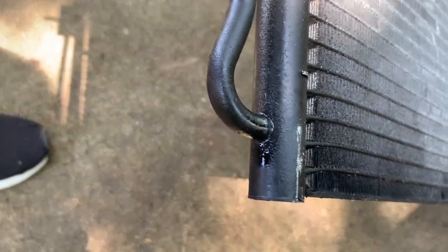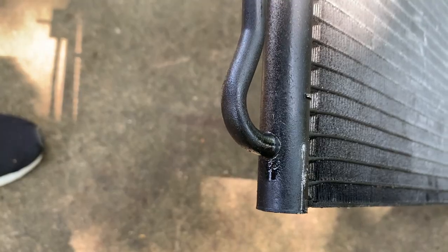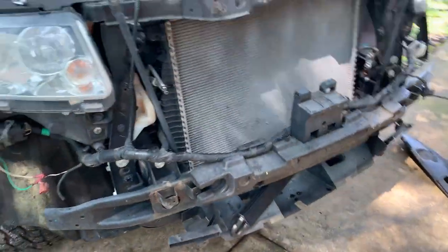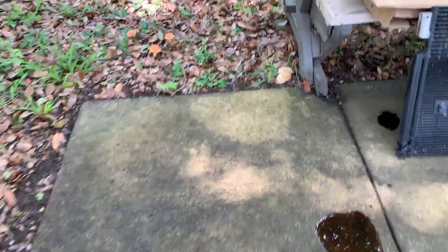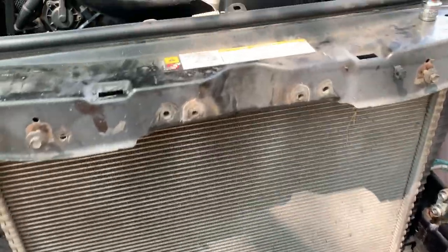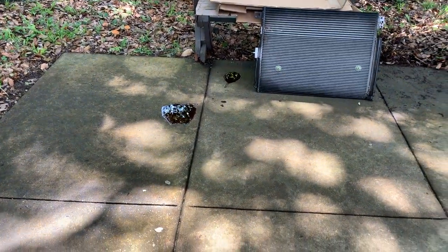Pretty wet right there. That would be where I would lean towards that joint, is where it was leaking from. Case in point, there will be trans fluid in there, right? And they talk about how much fluid might come out of there. You may want to add some trans fluid back in. Half a cup. It's not that much that comes out, but figure half a cup is what you're gonna put in there.